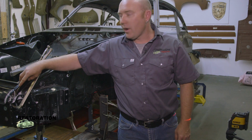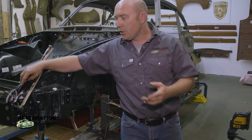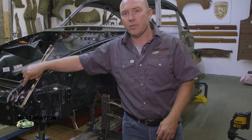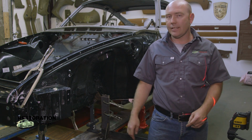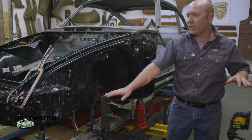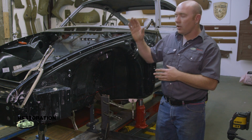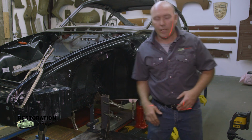On our website, we have all of our drawings that we use. Most of them are posted. You can go to our website, and the measurement from this very front hole that mounts the fender on down is 8 5/16 of an inch to the zero. So the laser projected across here allowed me to measure down to that. Also, the vertical laser allowed me to measure from here to that front point.